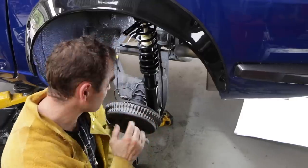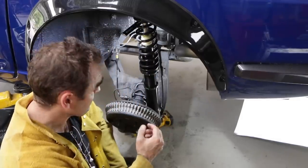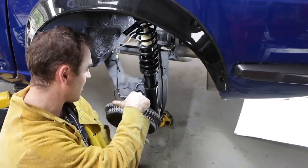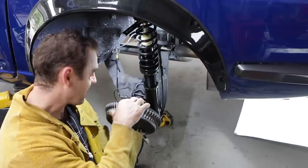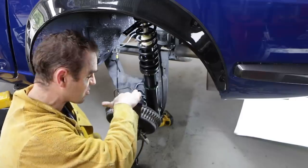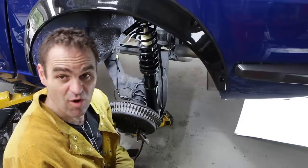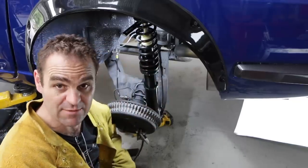Well, I was actually reasonably happy with how I was able to weld that. I managed to get all the plug welds in reasonably well. The one on this side, I don't know how deeply it penetrated, and I got the MIG all the way around, but on this side again, there's some bits where I've got a really good angle and got good penetration in the corner here, but the closest parts, which to be honest probably wouldn't make much difference on the bench or not, it's welded quite well, and I'm quite happy with it. It's definitely not going anywhere.